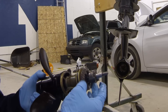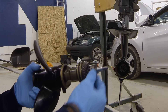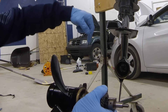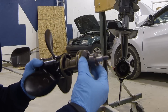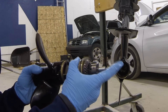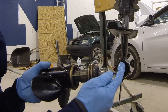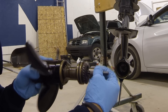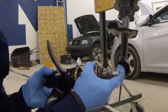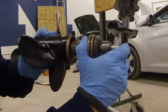It's important to note that both the reverse and forward ring gears always turn. There's a pinion inside that's always turning because it's connected to the drive shaft — as soon as the motor starts, the pinion gear turns, and it's directly connected to the ring gears. The only thing that makes the prop not spin is the dog being in neutral so it's not touching either ring gear. In forward gear, the dog touches the forward spinning ring gear, making the propeller shaft turn. In reverse, it engages the reverse ring gear, which turns the opposite direction, making the propeller turn the other way.